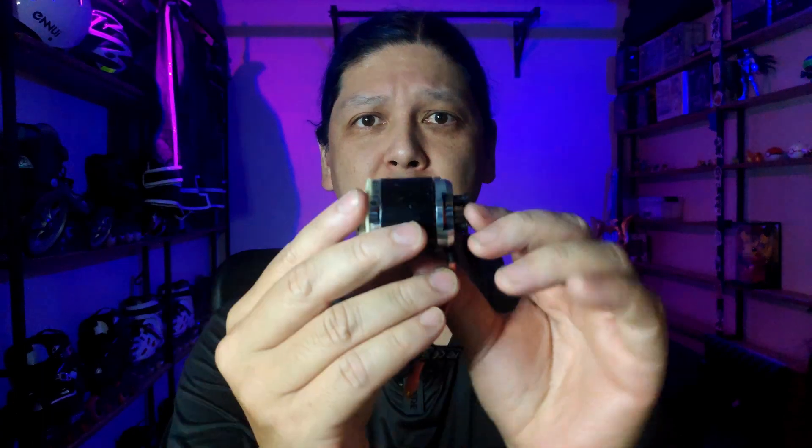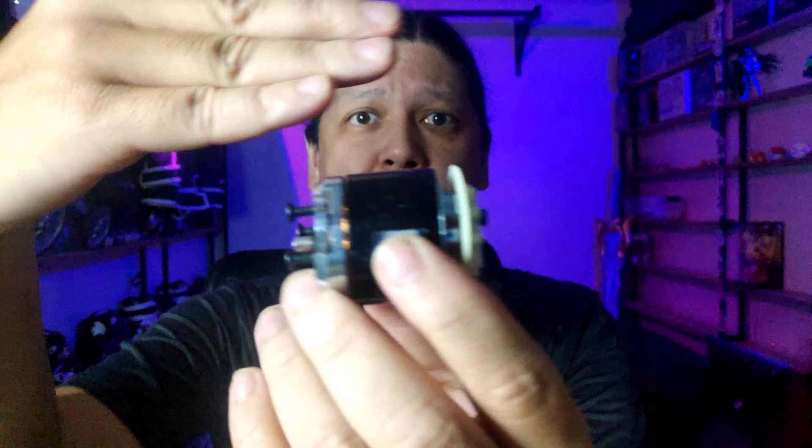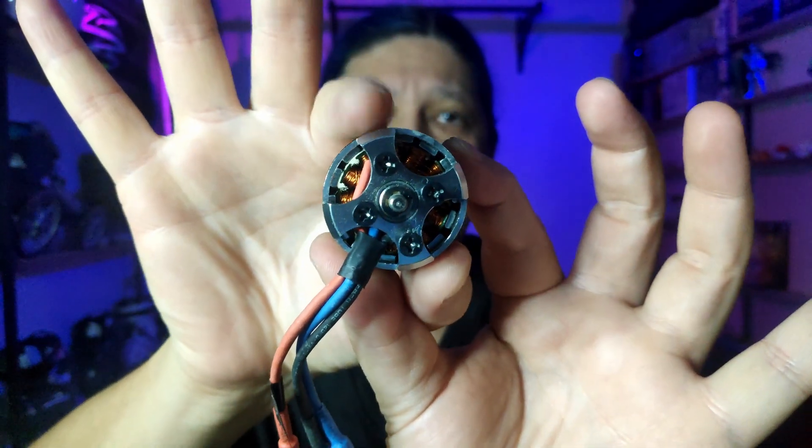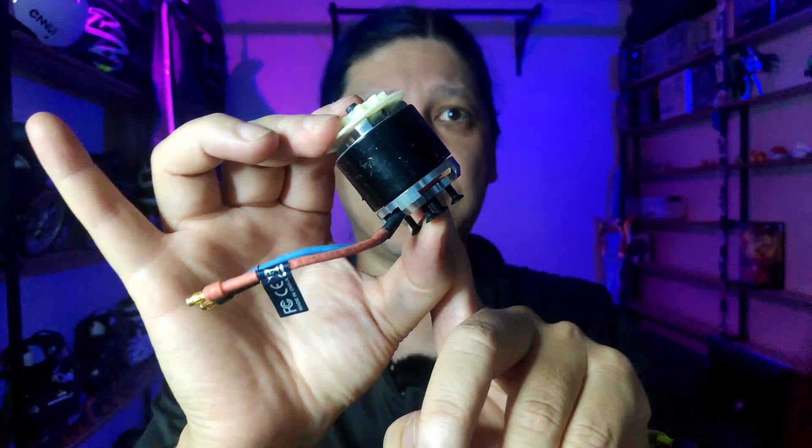I tried the airplane motor route. You can see here, this is a really small airplane motor. Usually, airplane motors are taller but smaller in diameter. This motor is a 35-37, which means it has 35 millimeters diameter and 37 millimeters height. I tried this one with a belt drive, but you know belt drive. This actually worked — I could move, but not a lot. This one is really, really weak. If you're trying it yourself, don't ever use such a small motor. They don't work, especially with a belt drive.